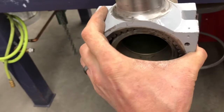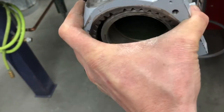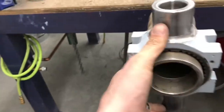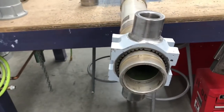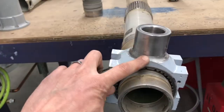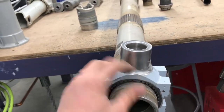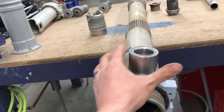If I slide this over there — it's a little tricky but there it goes. So now the drive gear is engaged, and remember that this is the spot that the semi-rigid rotor head is going to pivot on. This goes into our pillow block bearings, which allows for the teetering of the rotor head.